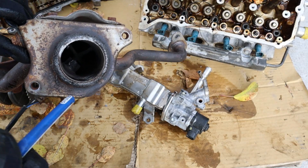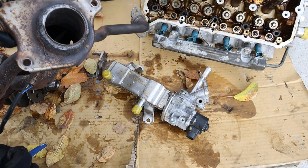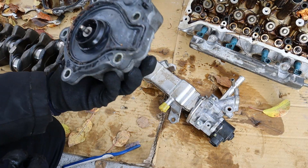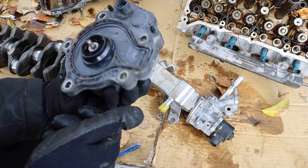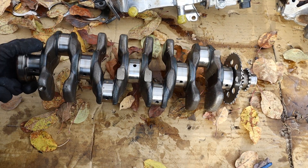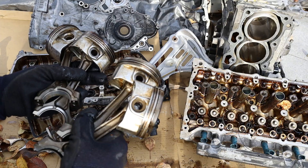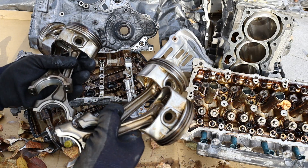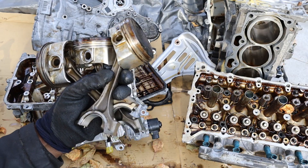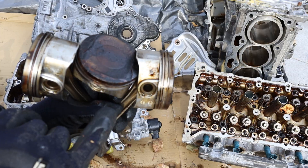Honestly, if there was a way, I'd probably cut off the EGR completely and try to disable it in the system — or maybe a resistor hack — because oil burning is not good for the environment, and neither is EGR when it fails. I read somewhere that these water pumps are actually a pretty good failure point on these hybrid engines. If you bought a Toyota because of the quality, check out that crankshaft — it's absolutely clean after almost 300,000 kilometers, that's pretty good stuff. But if you bought a Toyota Prius thinking there would be no maintenance, you'd better halve the 16,000 kilometer oil change intervals because that's part of the problem. If you've got one of these engines, make sure you pay attention to the oil and coolant levels. If it is starting to go, you might as well put new rings in it while you're in there — the updated version supposedly fixed this issue.